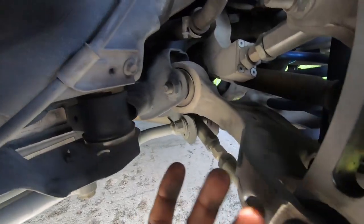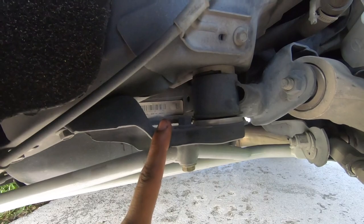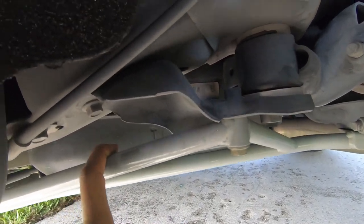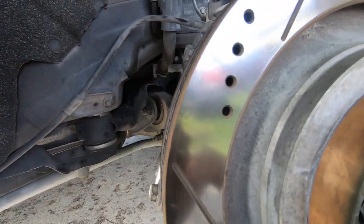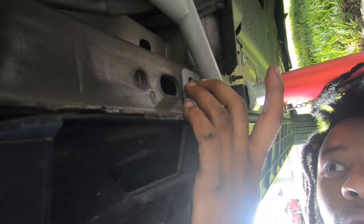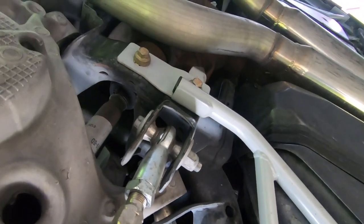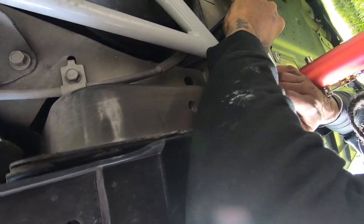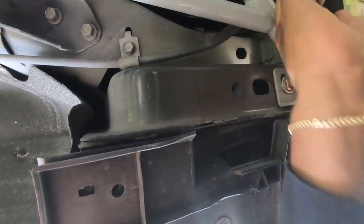So now, in order for us to drop this spring we will have to remove this subframe brace. But we can't remove the subframe brace unless we move the Steeda support - then we will have access to the subframe brace, which we can drop while we put the jack under it to keep tension so we don't have a mishap. To remove this support brace there's going to be three 15 millimeter bolts - two in the back, one in the middle - and then two 16 millimeter bolts in the back holding the brace. It won't be this hard if you don't have all the extra suspension stuff. Y'all go check out all the suspension mods we did to this car because we kind of went crazy on that.